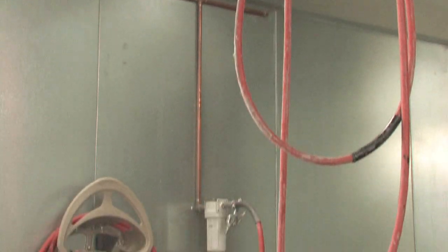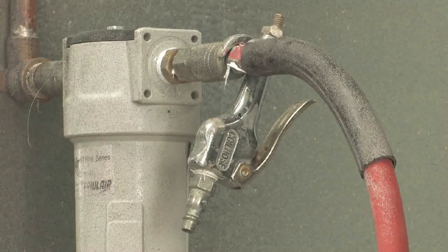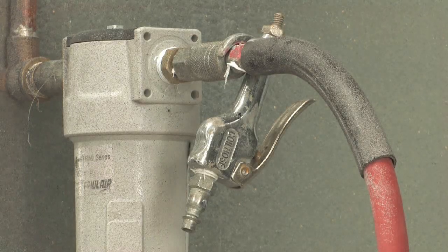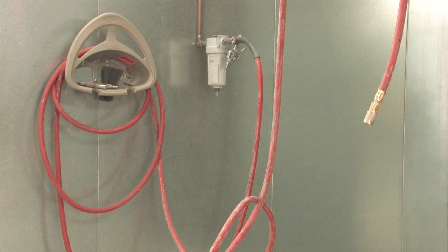You need to make sure that you have enough compressed air to run spray guns. You're going to be spraying for potentially a couple of hours and your compressor is going to be running nonstop pretty much the entire time, because you're going around the car spraying two or three coats. You have to have a compressor that can keep up with that.